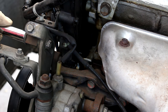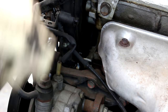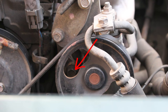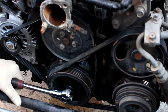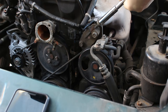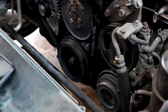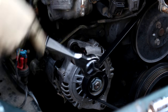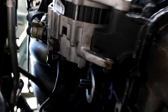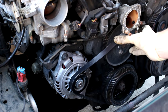Before loosening the accessory belts to get to the power steering pump, loosen these three 10mm bolts that hold the water pump pulley on — they're really hard to get loose once you remove the accessory belts. I'm not going to fully remove the power steering pump to where I need to disconnect the lines; I'm just going to unbolt it to get it out of the way. First loosen up the tensioner bolt, then you'll have a 14mm in the front of the pump that you access through the pulley. Loosen that up, loosen up the actual tensioning bolt, and then the power steering/AC belt will come off. Same concept on the alternator: loosen up the 12mm bolt on top, the tensioning bolt, and then a bolt at the back of the alternator — this whole assembly will come loose and you can remove the alternator belt.